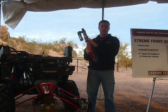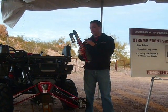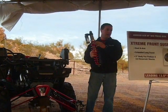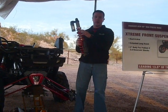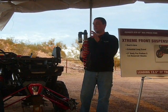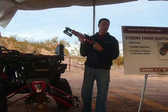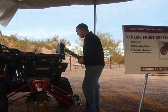The fronts have a single spring that takes care of that dual rate. On the rear, we've got the two springs. We got the dual rates, with the lighter spring rate for the initial ride-in and the stiffer spring for handling and bottoming resistance. On this vehicle's top and bottom, and in the rear shocks, we went to the larger M12 bolts this year to keep everything together.